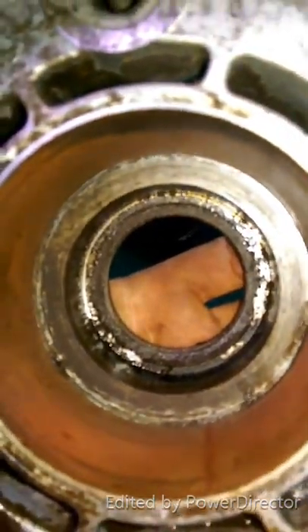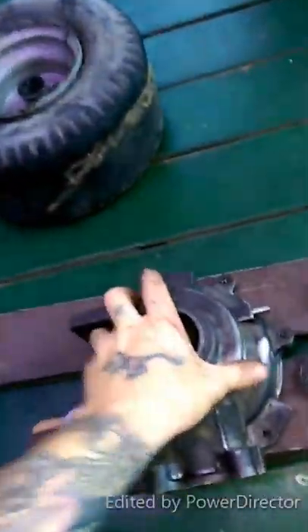I'm going to clean this up a little bit more and then reinstall the new ones in both the covers. Putting this cover in — I get a seal, I'm just pressing it in by hand, making sure it's level all the way around until it's flush. This one's all in, nice and flush. That's the way you want it. And we're going to put the other one in here the same way — nice and flush.